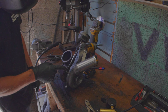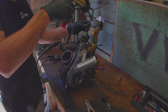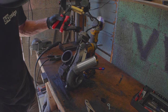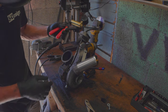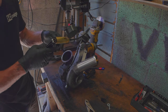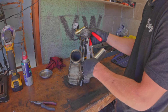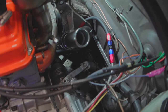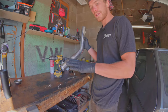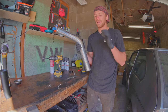Right here's the moment of truth. I got my linkage jankily welded to the rest of the linkage - we're going to see how this will work. And that's full extension, and that's full vanes. So we're good. I'm going to weld that better and clean up. Got the turbo in the car. Basically the actuator from the TDI turbo fit up great. I did some quick fabrication, a little polishing it up, and that all went super smoothly. Turbo's back in the car and looking very nice.